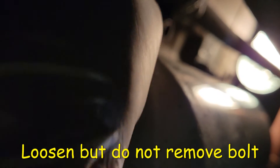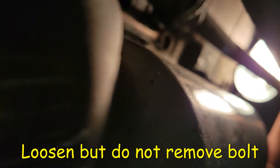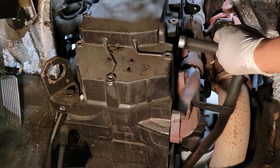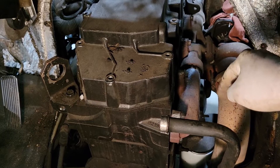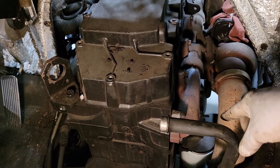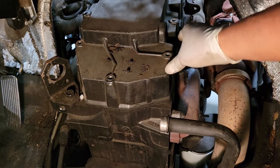I'm going to break the bottom bolt loose — again, we need a 13mm. This bolt is going to be in between the tube and the oil filter. You just want the tube out of the way. I would definitely leave that bolt connected because it's kind of aggravating to get to unless you're going to remove your oil filter. Now we're going to lift up on the valve cover.